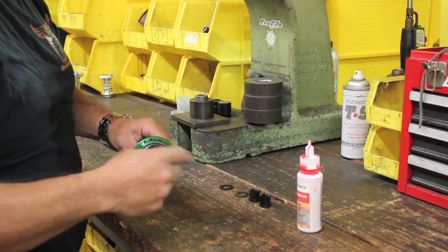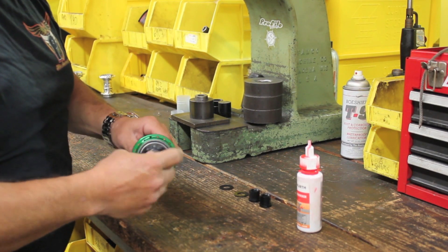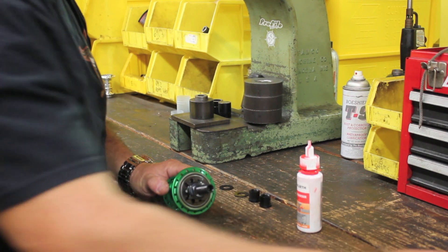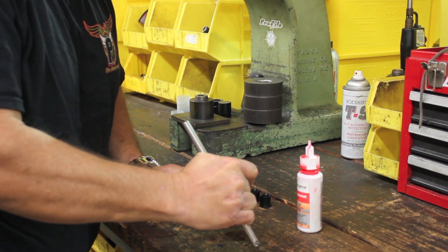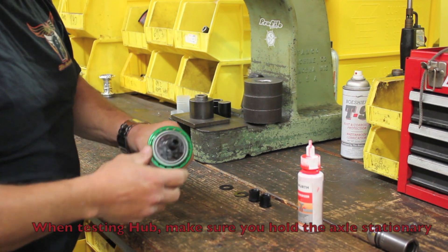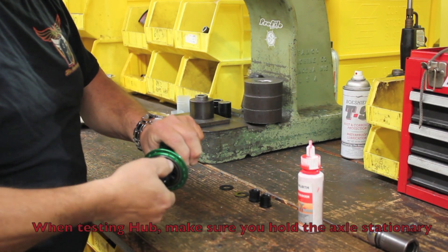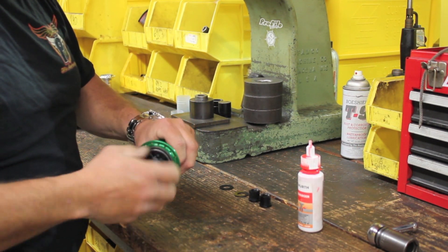Take the jam nut for the drive side and put that on. Both sides cone. Then go ahead and tighten them down. I would suggest somewhere in the 50 to 60 inch pounds of torque, which is quite a bit. Now we can test it and see if it works. You can hear it when it goes to stop — it clicks, then it engages, then it clicks the other way. You'll know you have a good center spacer.